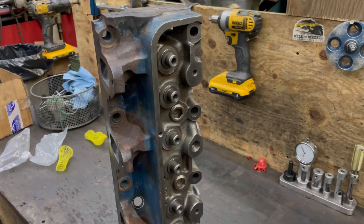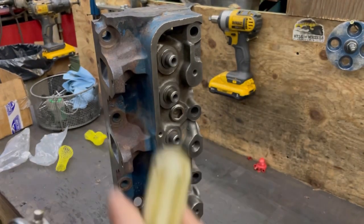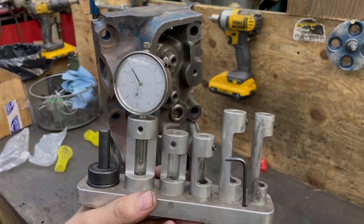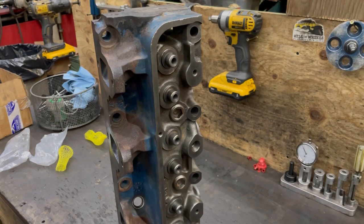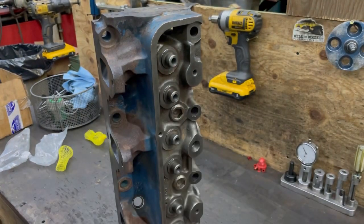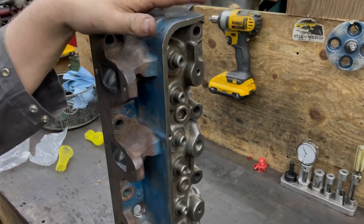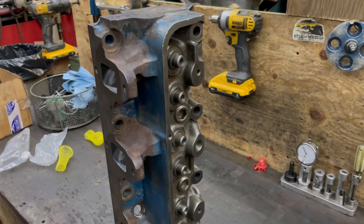This isn't a really long video — I just thought I'd talk about it a bit so you guys have some context. If you are putting a set of cylinder heads together, you should be measuring this stuff. Not everybody will have a dedicated gauge set, but they're not super expensive if you're building an engine. You can also do it with a set of calipers or make a gauge. A couple thou doesn't make much difference, but 20 or 30 thou does — especially if the cylinder head or block has been surfaced, or you're putting different heads on a different block. Remember: like, subscribe, hit me in the comments, and it's not rocket science.